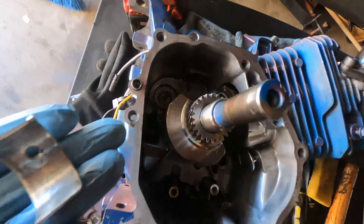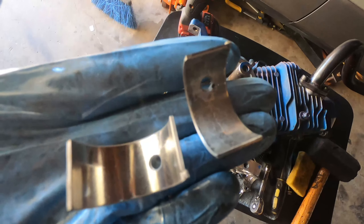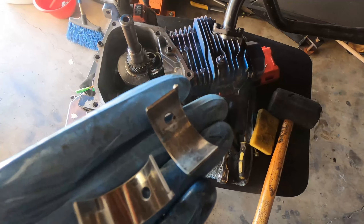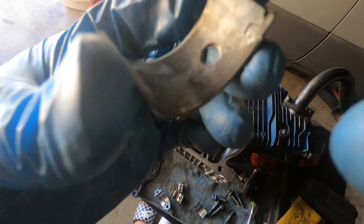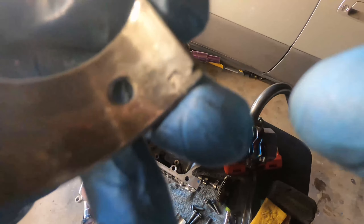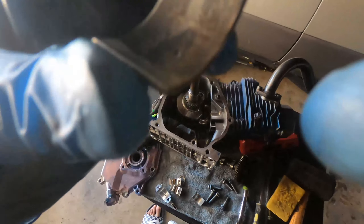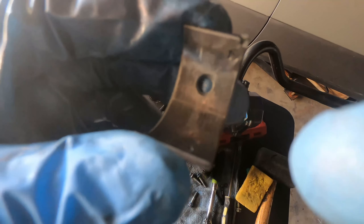You don't even have to take the rod out — just rotate the crank and that side's gonna fall out. So we're gonna put it back in and show you everything. This is the other half — the piece on the rod — and the damage is in the same area and at the bottom on this one. It's not that bad but at least I caught it.